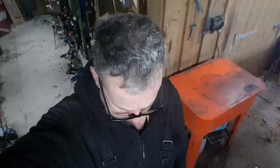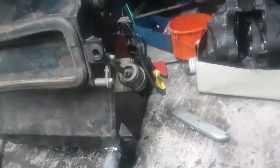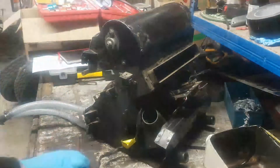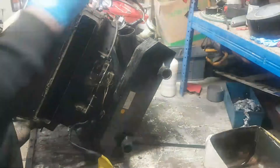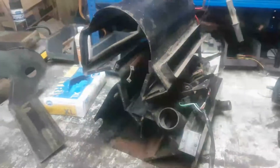You're also going to see various continuity issues with my hair because I've had it chopped. Is there a bald patch? No, there isn't. But it is very grey. Good call, Tim, on the heater matrix. I pulled it out, attached up my test rig, pumped it up and it holds very little pressure. Luckily these are slightly easier to get apart than the later ones because there's just a series of screws around the edge. I'll take one end plate off and should be able to slide the entire matrix out. Right, very quick heater matrix fix jobby here.